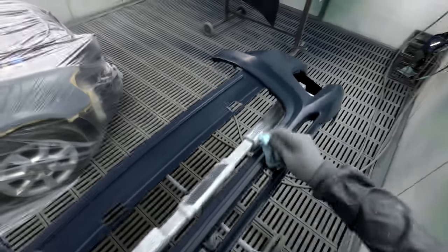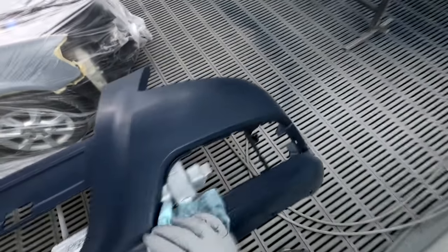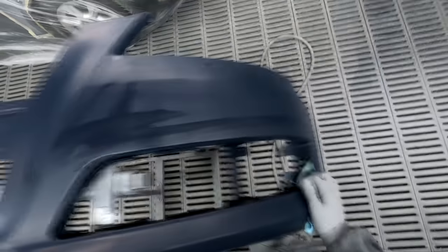When you go up to the proper HSs and the low VOC clears, you're going to be getting a much thicker clear, and it's a lot more forgiving, I've found. Some of the orange peel that you'll get in your wet on wet, with the good clears, you'll just be able to pound that clear on and it will forgive, if you know what I mean. You won't see it because that clear coat just holds such a nice gloss and it'll flow out and hide the fact that the wet on wet wasn't down perfectly.